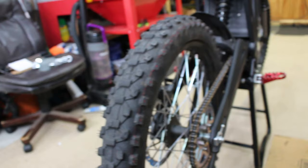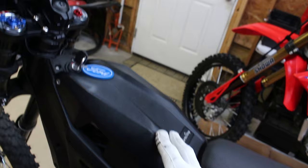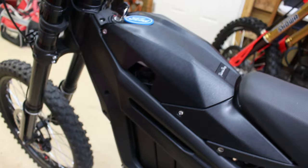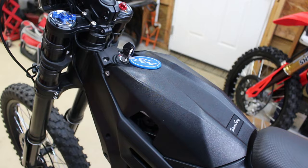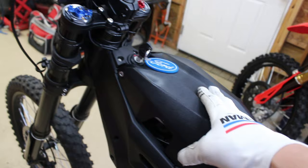Another thing to talk about is battery maintenance. You do not want to store your battery at 100% or very low near zero. If you let things sit too long with too low of a charge, the battery voltage can droop below a level where it can be charged back and then you have to look into jump-starting it with alligator clips and other methods. These bikes ship with batteries at 80% — if you know you're not going to ride right away, don't charge it. If it's at 80% from the day before and you're riding the next day, charge it for an hour before you go. Store batteries around 80% — probably a reason they ship that way.